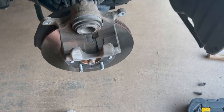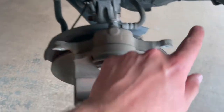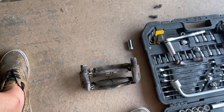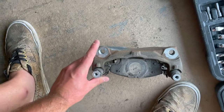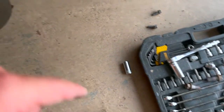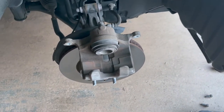These are super easy to take off — way easier than I thought. There are two bolts right here, I think they're a size 13, and you take those off to release this part of the brake caliper. Then this is still sitting on the rotor and there are two bolts back here. These are pretty hard to put on — they've got some red Loctite on there. I have blue Loctite so I'll just use that. Those just attach back onto these two points, but it's extremely easy. I think that took me less than five minutes. Let's get back into this time-lapse — I'm going to put the new pads on.